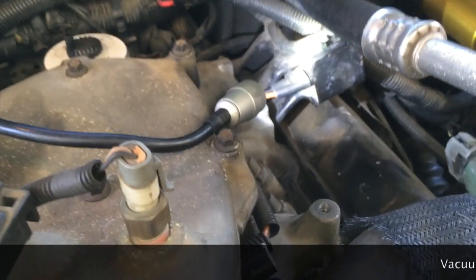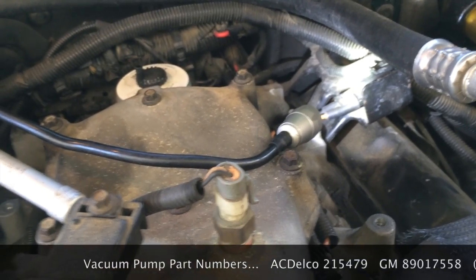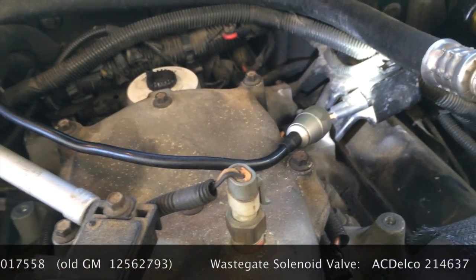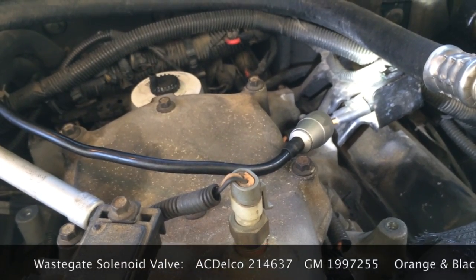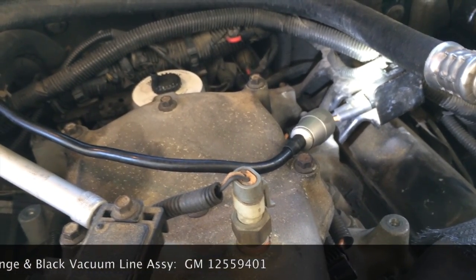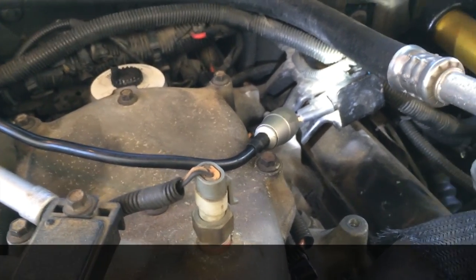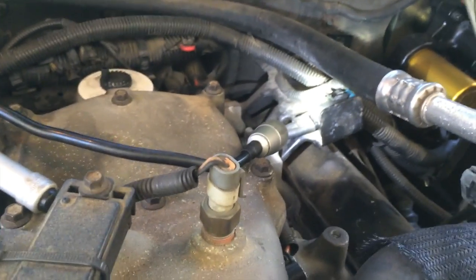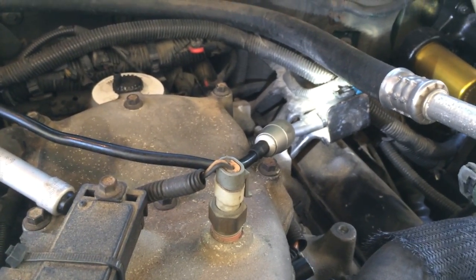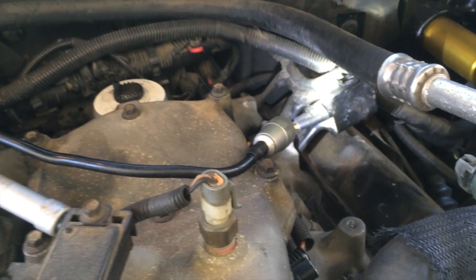Some part numbers here — I'm always using GM parts. That vacuum pump is an ACDelco 215-479, currently GM 890-17558. Highly recommend GM ACDelco parts. I've had this vehicle since brand new in 1999 and have only had to replace that pump once. On the wastegate solenoid: ACDelco 214-637, GM 199-7255. The one I just replaced is the third one since I've owned the truck. These are not parts you want to go cheap on — not the store brands or off brands. Get something high quality.